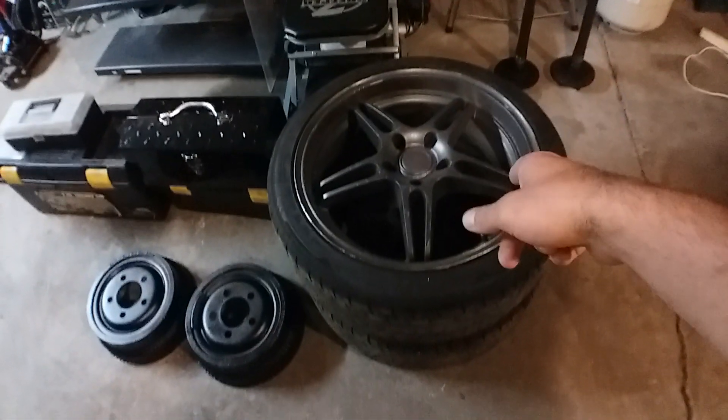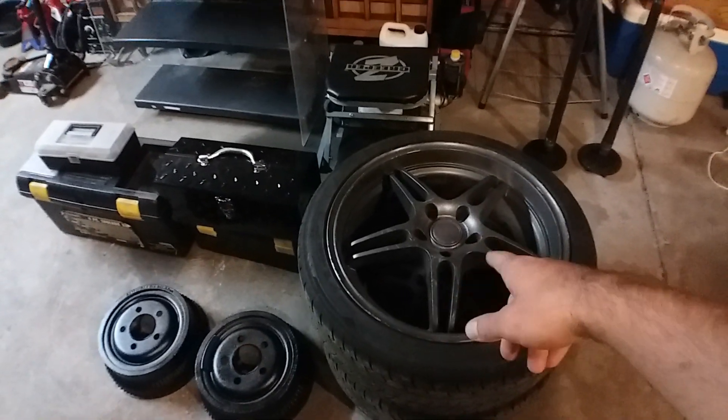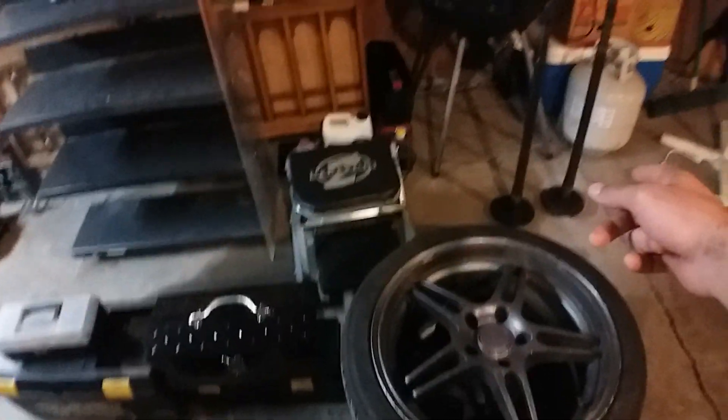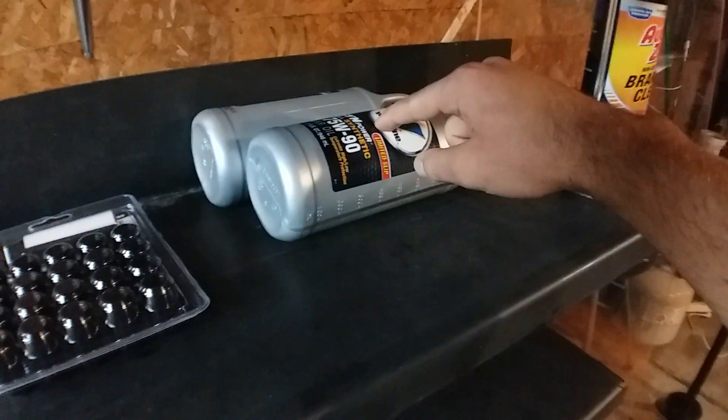My tires that are currently on the back shake and vibrate and they're just rough, so I'm going to be doing the rear first. Plus these are way wider — the truck currently has 205-wide on it and these are 225 or 235, I'd have to check. I got my axles — these are five-lug axles off of a 1988 Dakota with an 8-and-a-quarter and Trac-Lok, because early Dakotas were five-lug and then they switched to six-lug after.